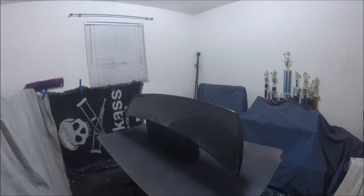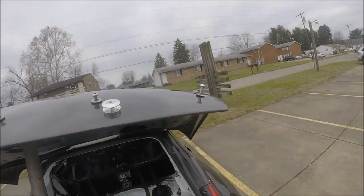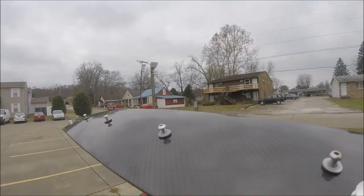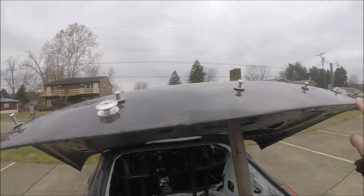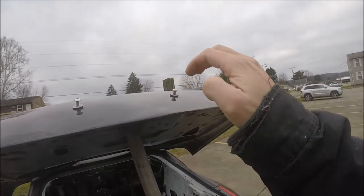Yeah. What up, YouTube? It's a new day. It is absolutely freezing out here, but I'm ready to get this wing back on here, man. The wing is done, officially clear coated. So right now I'm just going through, getting all these bolts off here so I can get this thing back on. So let me freeze to death and get all these bolts off and we'll go from there. And for those of you wondering, yes, I am going through and replacing all the rubber washers. Anytime you use those once and mash them down, you want to replace them after that.